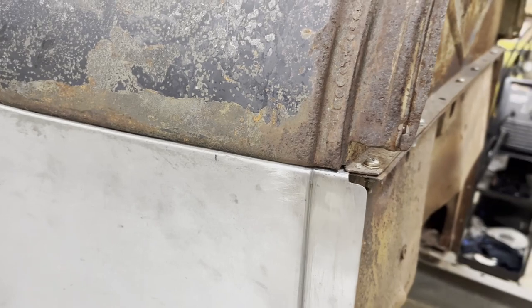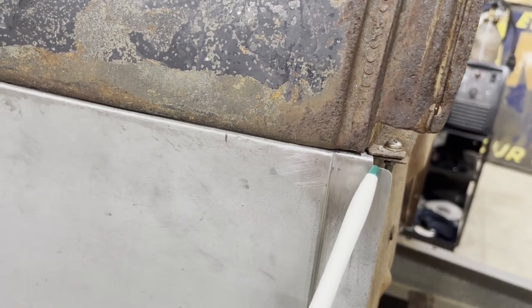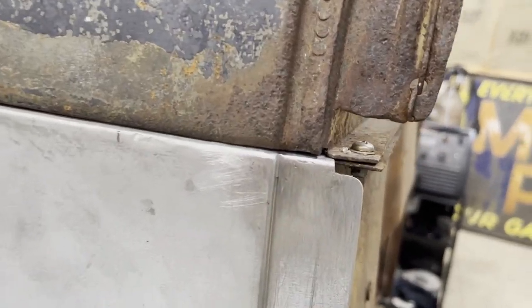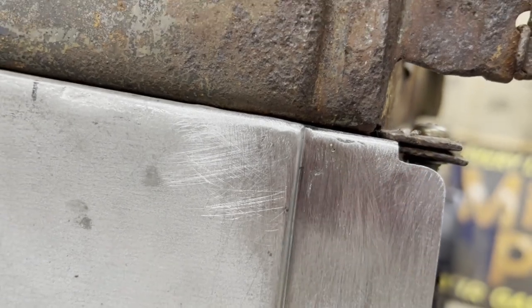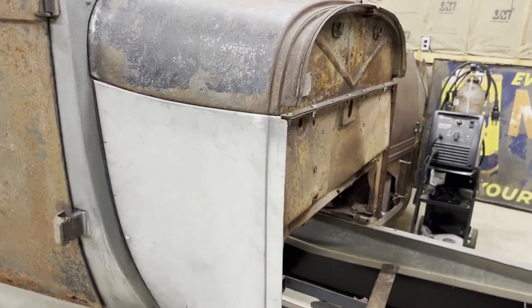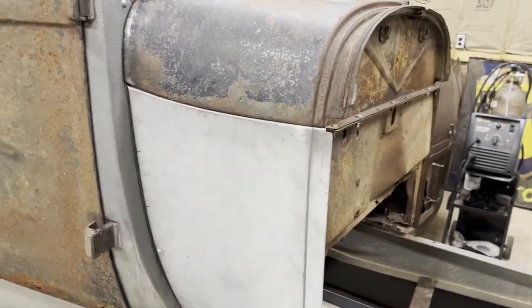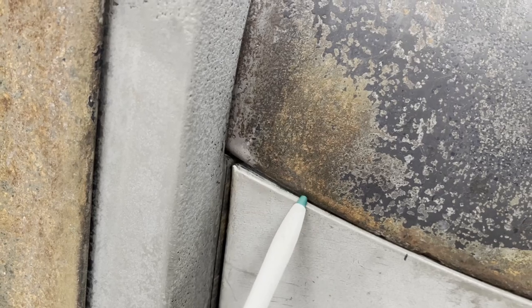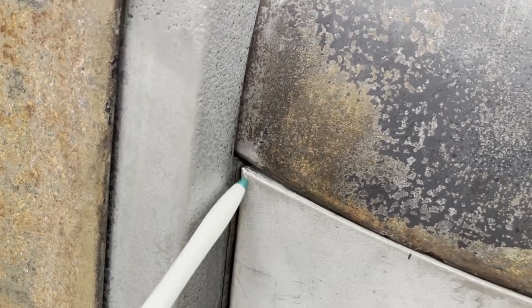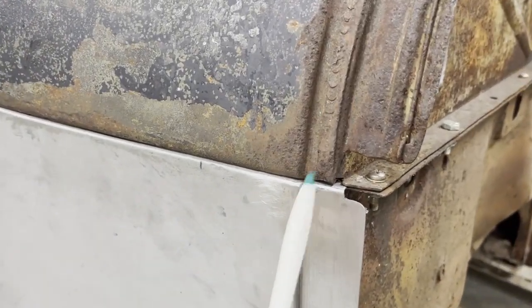Oh yeah, I'm happy with that — that looks good. There's only one thing I'm not sure about, and that is since this panel was cut too short here and I had to hammer that over, I ended up with a little bit of a notch there on the end. I may come back and weld that up — I'm just gonna have to study on that a while. It doesn't look bad like that, but time to fix it is now. Now I've got to do the same thing on this corner where this top flange meets the flange that goes down the backside — it's got to be welded in there too. I should have done that when it was off, but I got ahead of myself, got excited about sticking it up there and seeing how good it looked.